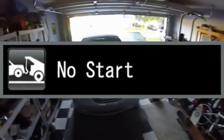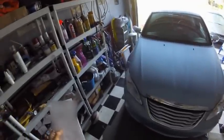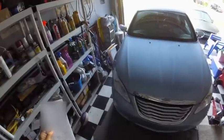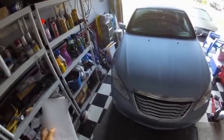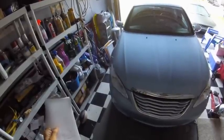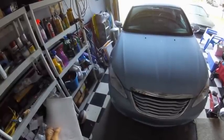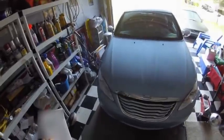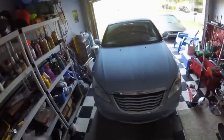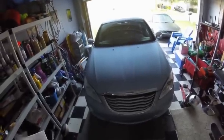Video 2 of the problem I'm having. I'm going to try to resolve the issue where my 2013 Chrysler 200 has a no start, no crank issue. Looked online. There's a guy with a Chrysler Pacifica, I think he's Dealer Specialty Services of PA. That's the name under the YouTube channel. Basically all he did was add an additional ground wire to his Pacifica, to the tranny, and it fixed the issue.